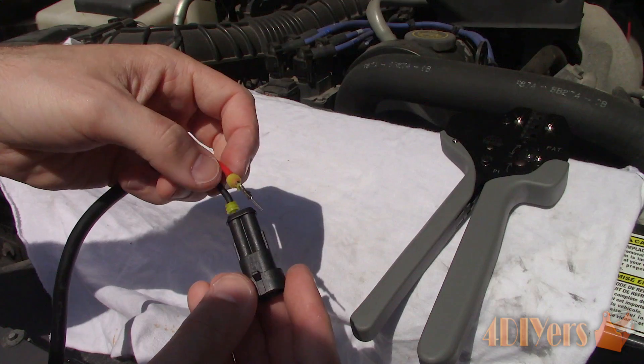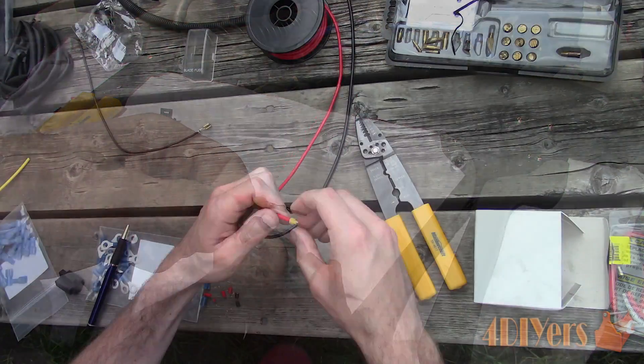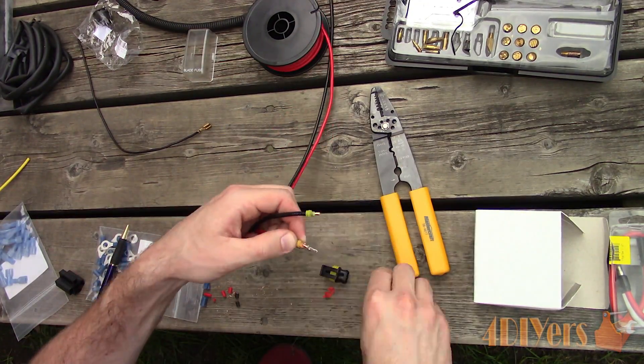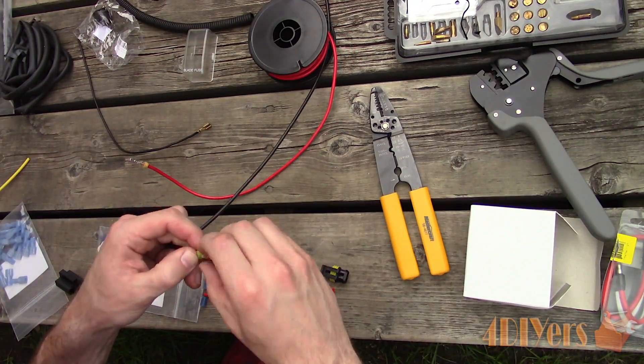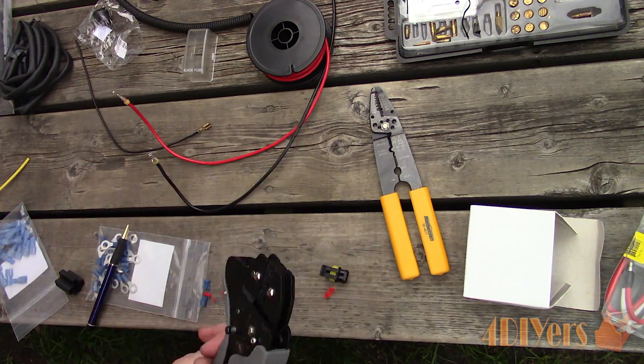Install them in the case. Now install the male connector on the other side of the wires. The plastic housing is only the male portion, while the contacts within the connector are the female portion. The power side will have female contacts, so if the light switch is disconnected there will be minimal risk of the connection shorting out if accidentally switched on.